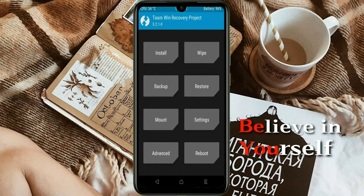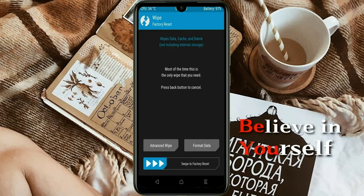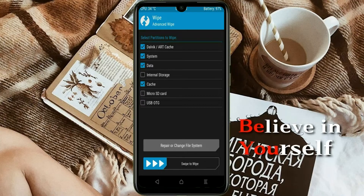Press on back. By wiping this temporary data, it will allow a clean install of this custom ROM. Select wipe, then select advanced wipe. Select Dalvik cache, system data. Swipe right to confirm.